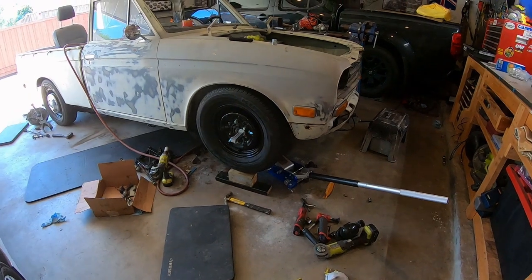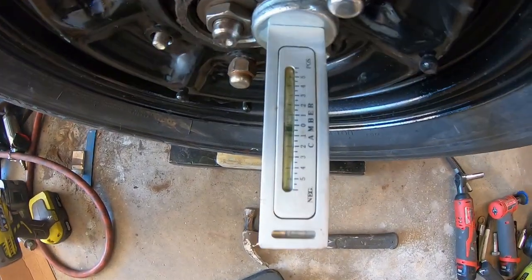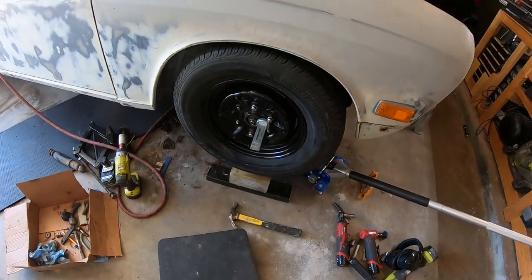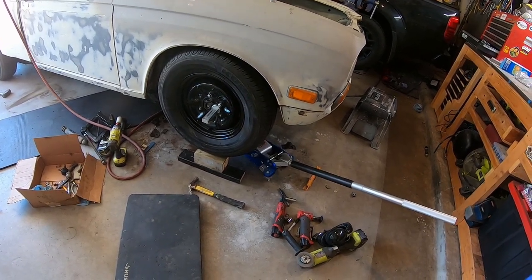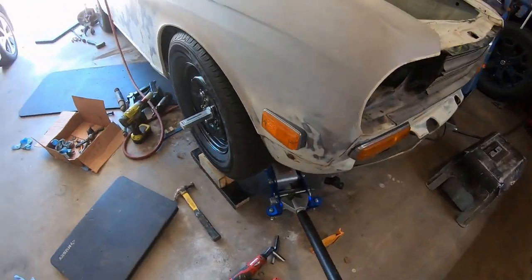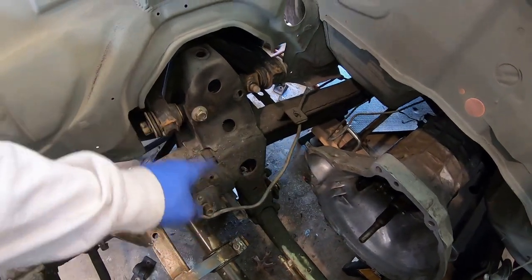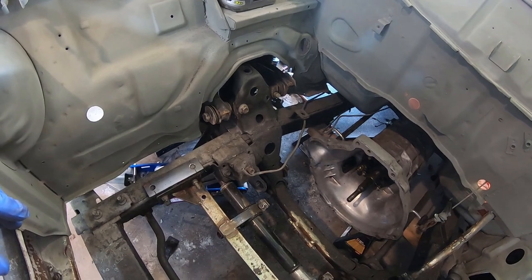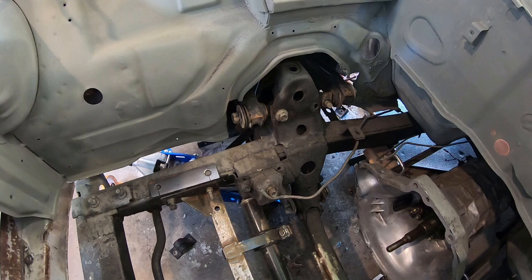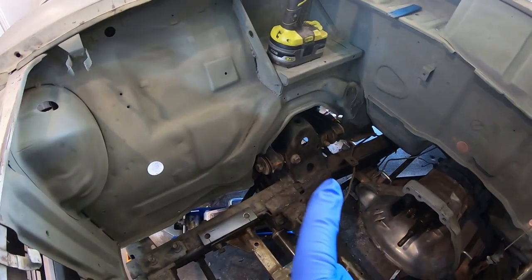So there it is — bottomed out with the stock control arm and wheel on. I've got like one degree of camber. I just looked in the factory service manual — it can be from zero to one, so that's technically within spec. But if I lower it down to stock height, I get almost three degrees of camber, so something's not right. I looked at some old pictures of my other 95 hard-body. I think this bolt needs to line up with the front control arm — the whole thing needs to go farther back. It says eight to nine degrees of caster, and I only got about five right now, so the whole thing needs to move over.